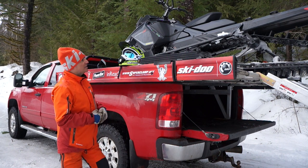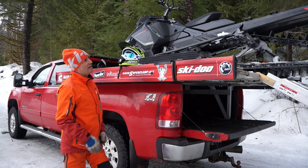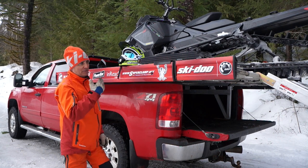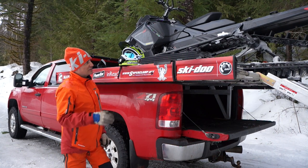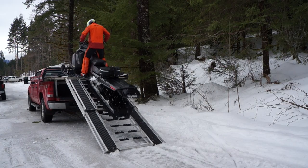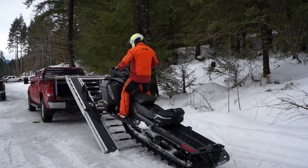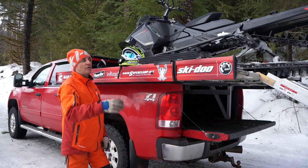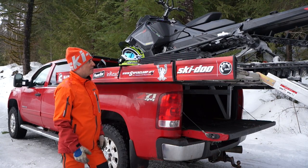What you really need to remember when you're unloading your sled is — you can see I bend up my snow flap, and that way when I back down the ramp it just continues right off the trailer. It doesn't get caught under the track; it's just a nice smooth, easy off the deck. And once you're on the ramp you can kind of let gravity do its thing and just pull you right down onto the ground, back off, and you're good to go.